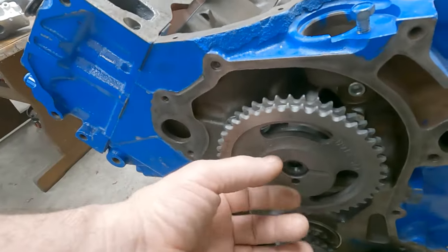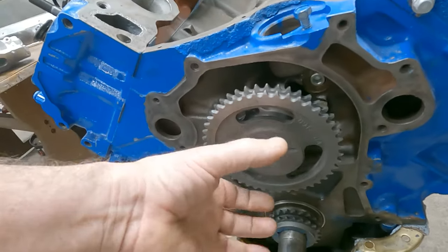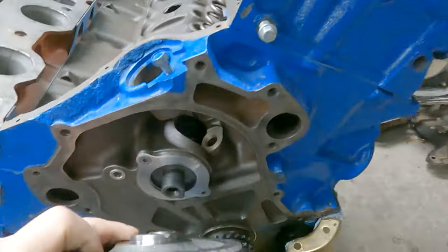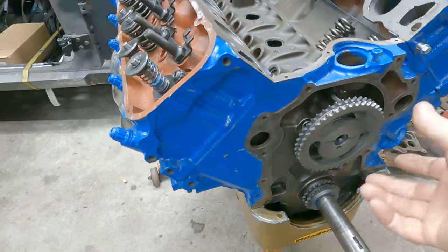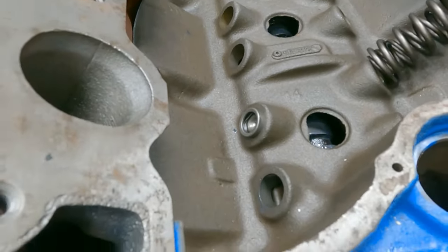It had the eccentric for the fuel pump and it was stuck — it couldn't turn. Put it back together after I found out what cam it was. Wasn't ready to put the chain and timing set on yet. It's easier to just turn the cam checking push rod length versus spinning the whole motor over.